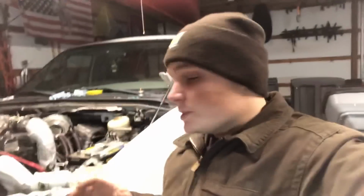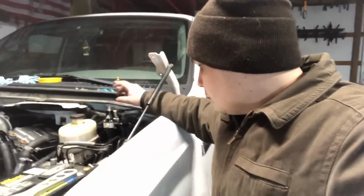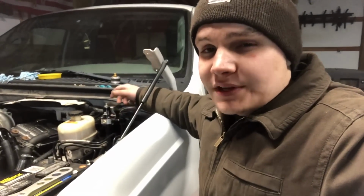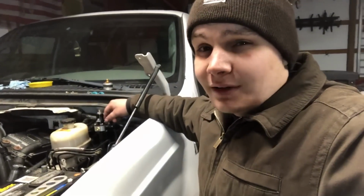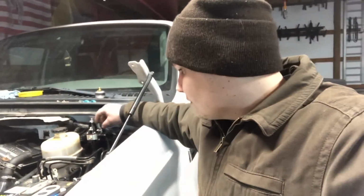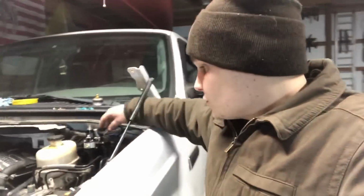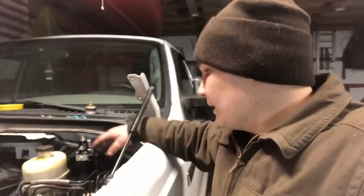So I think that's going to wrap it up for this video, guys. We got a lot done. We got a lot accomplished. I do want to mention one thing. A couple episodes ago, I talked about my regulator. We set this thing up, and it's got this little boost reference port on the side. I misspoke. I did a little bit of research. I was initially going to plug that, but from my research, I've determined that if you're not going to be using the boost reference port, this regulator actually uses it as a vent because of the diaphragm in there. And you can actually get a special fitting that goes into here that has like a small screen on it and stuff. So we are going to be leaving it like that. We shouldn't have fuel coming out of there anyways.